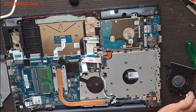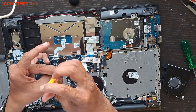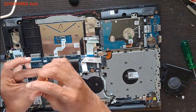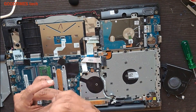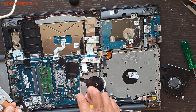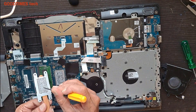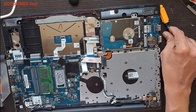Now if your laptop is older than around two to three years, just remove the heat sink. Be careful — if it slips it may damage small components on the main board, so make sure the screwdriver won't slip. You can see a shining part there, which means the processor is not getting connected completely to the heatsink because there's no paste here, so I need to apply the heat sink compound.